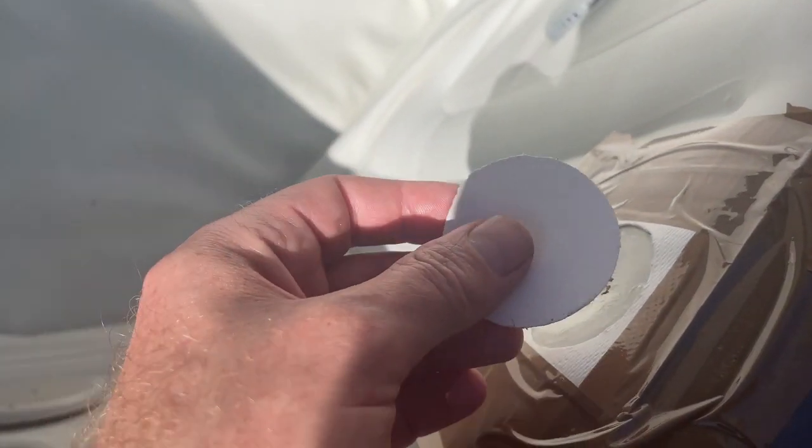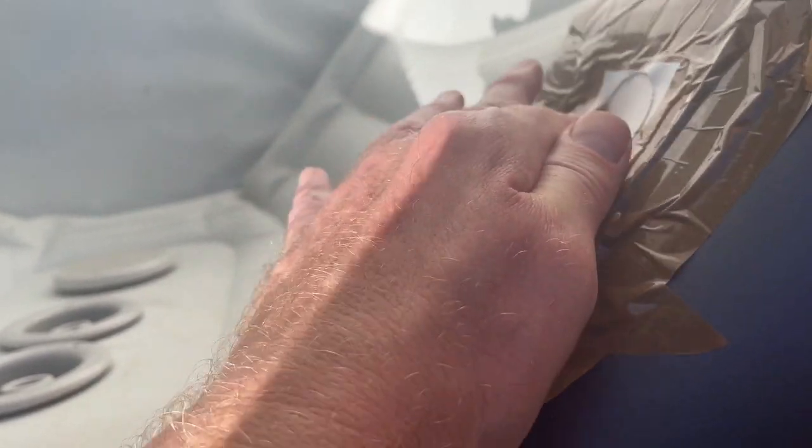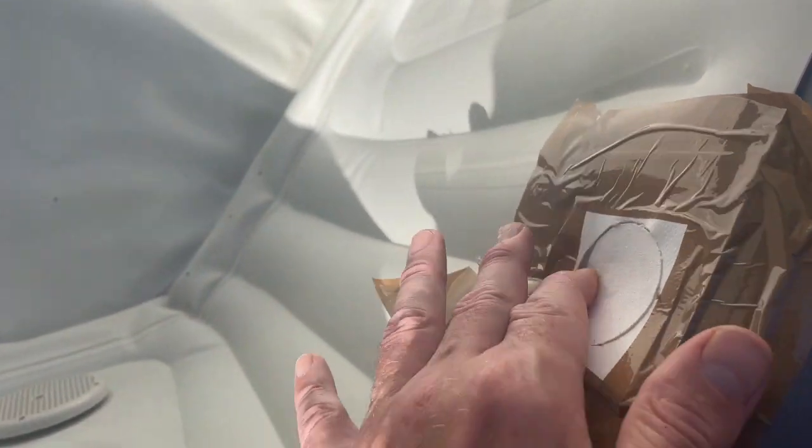On the last layer, wait another two to three minutes and then adhere this to the hot tub. So I'm going to apply the patch. I put the template onto the top, then apply the patch, press it right in, expelling all the air from underneath the patch. This is pressurized, so now I want to let the pressure out of the hot tub. Let your pressure out and leave it for 24 hours, then retest your patch.